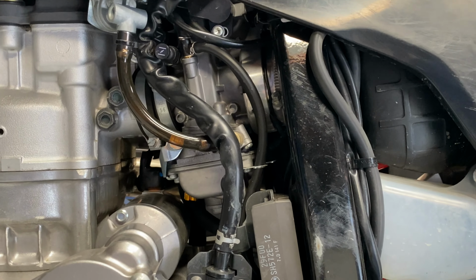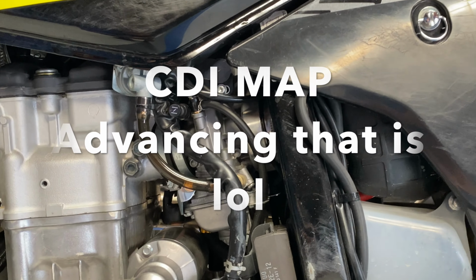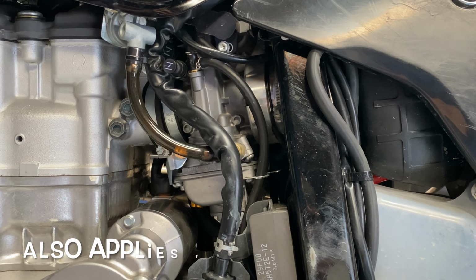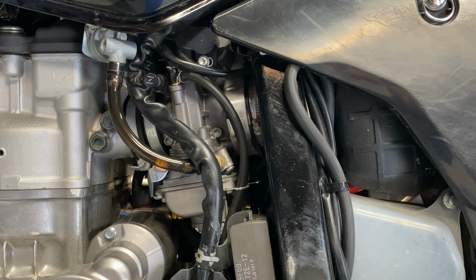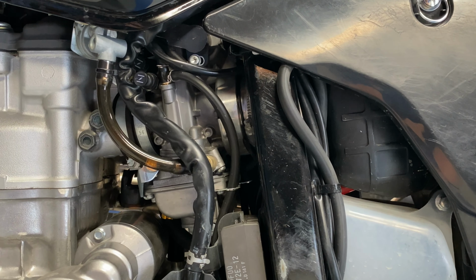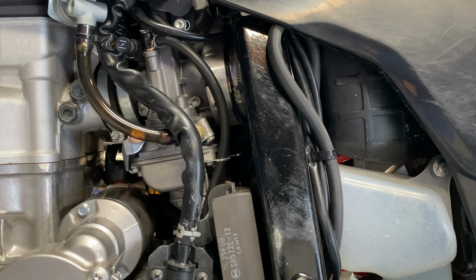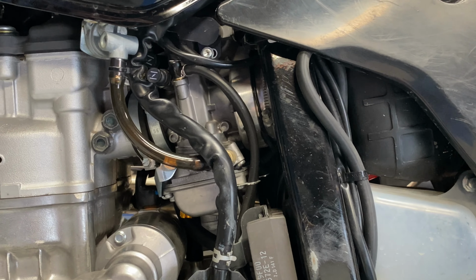There's also things like the TPS you can adjust and advance it a little bit, help your motor be advanced for the type of ride you're doing. If you're really hard on the bike, you're not worried about fuel mileage, you want more response and power, it's okay to turn that a little advanced, to turn it clockwise. We have ours maxed because the DRZ, I should say, not the DR650, needs some help with the power factor. You know, she's 80 pounds heavier than your normal motocross bike, so. Yeah, let's go rip it. See how she runs.